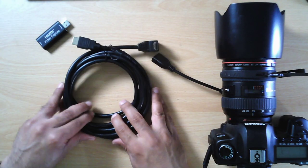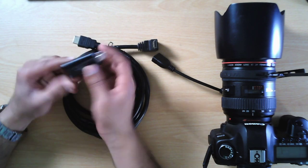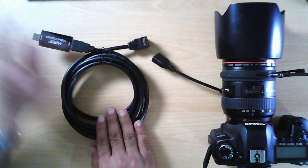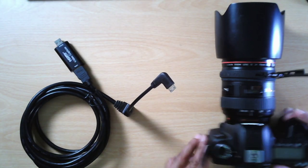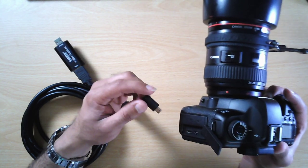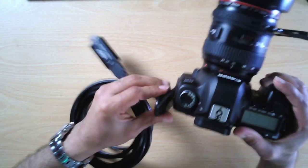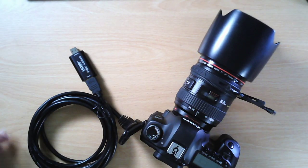Here's how to set up an HDMI capture card with any camera. These are the cables you need: a capture card — a cheap one from eBay — with a USB cable to plug into your computer, an HDMI cable that plugs into the capture card, and an important smaller cable that plugs into the camera. The camera I'm using here is a Canon 5D Mark II. The longer the HDMI cable, the further away you can sit — that's your wiring overview.